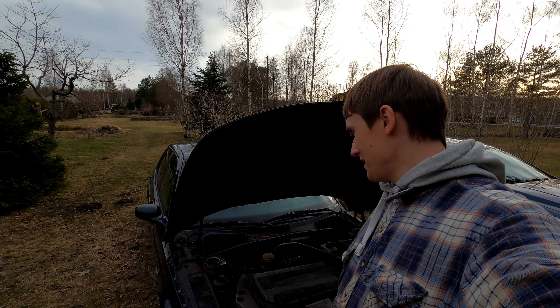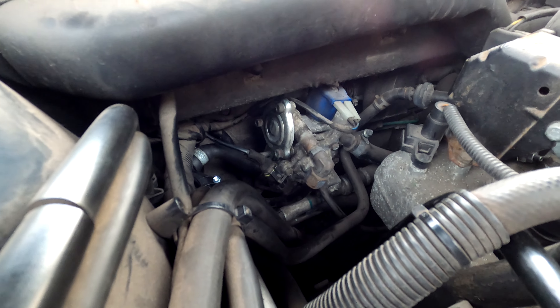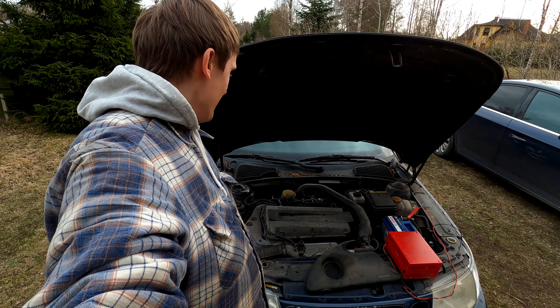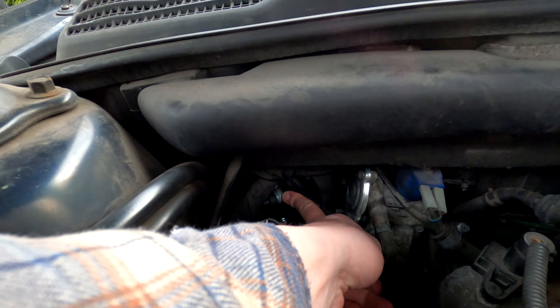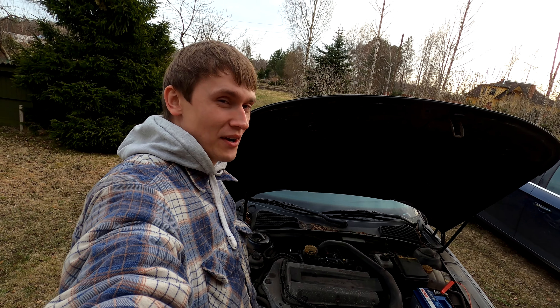We do have a leak — I can already hear it. Somewhere down there. Another day, another attempt. What happened yesterday: that stupid thing — what I did was I put the liquid phase filter in the wrong way. So there was no gas supplied and of course the engine stalled. I switched that around, but when I tried to start it I had leaks — over here and over there. So today I will try to seal them, and hopefully we can finally get this thing to run on LPG.